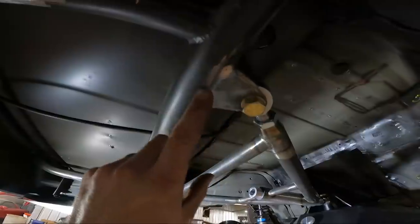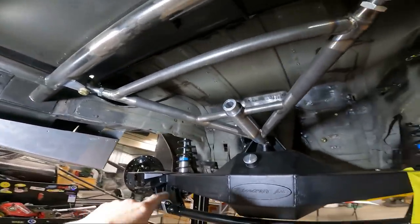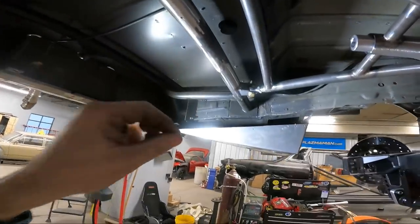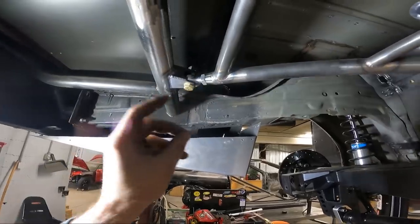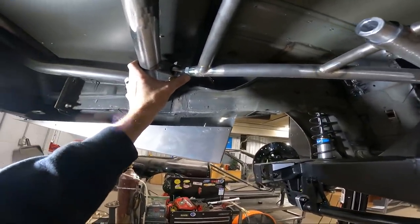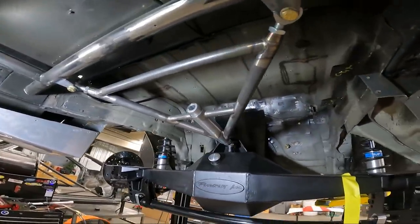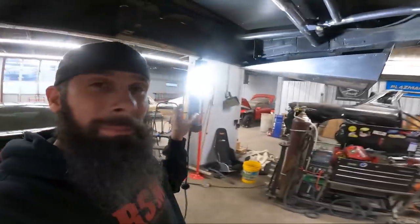You can see our chassis tabs here — we've got them welded all the way around, nice and beefy. We've got this thing in place where we want it. We don't have any misalignment spacers in here yet; we have some ordered that are tapered at the end, because the ones we made were straight but it really needs tapered ones to give it the full range of motion with these rod ends. Definitely a beefy piece — I highly recommend if you're looking for a wishbone setup you check out Hammer Concepts and Designs LLC. I'll put the link to his website below.